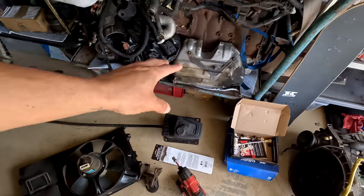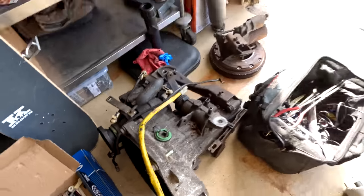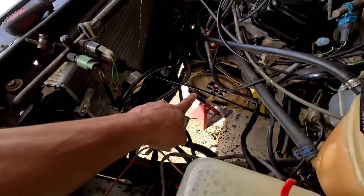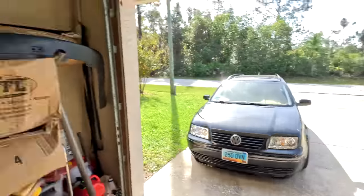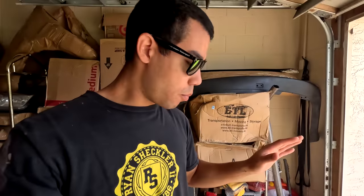After that we have the manual pedals to go in, the manual shifter box, and of course the manual transmission and our clutch. I still have to pull off the old flywheel that's still down there. Hopefully we can get majority of that done today — this might be a three-day process. It could be done today, really just depends on how much this car fights me. With the transmission out of the way, which is the biggest part, I think we're pretty smooth sailing.